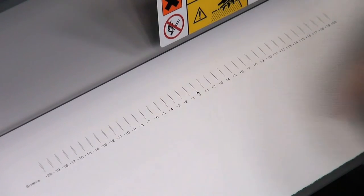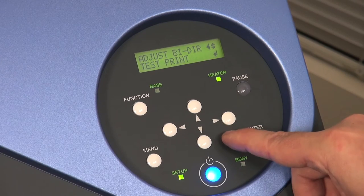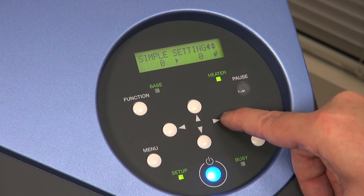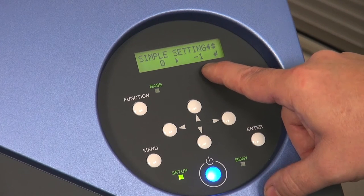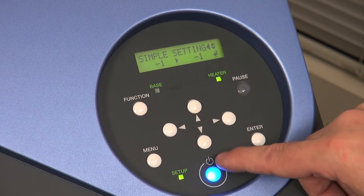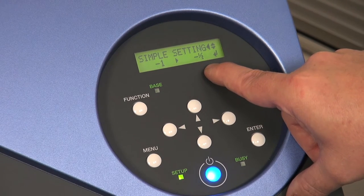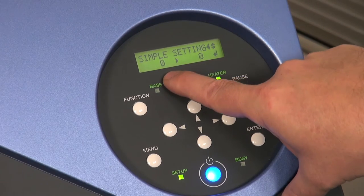Let's show you how that works. We'll go back into the menu, back down to adjust bi-directional, over to the test print, then down one notch to the simple setting. To adjust, go to the right — the setting is at zero now. If I want to change it in the negative direction I'll go down; if negative one is the desired setting I press enter and now it's at negative one. If I were to run the test print again, the triangle would move to the negative one point on the physical print. It was good at zero for this test, so I'll go back up to zero. Note that you can go in half increments, so if it's in between two values you can use that. Since it was good at zero, we'll set it back there, press enter, and it's confirmed at zero.